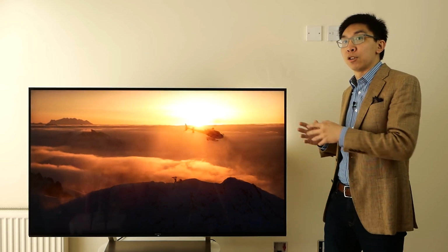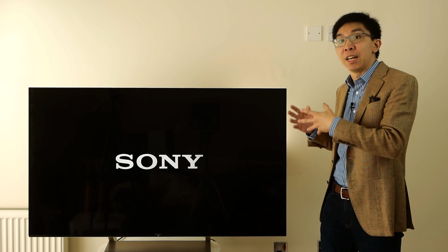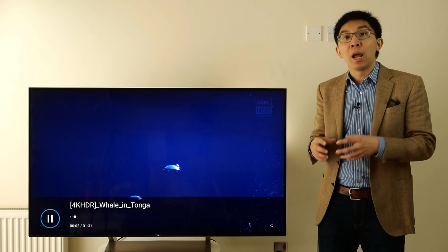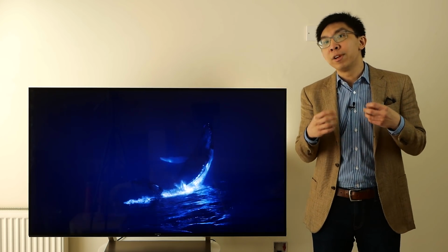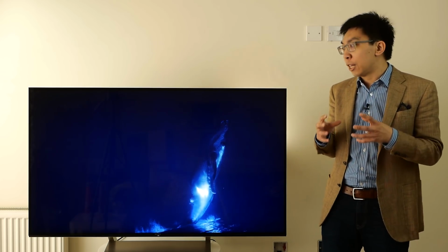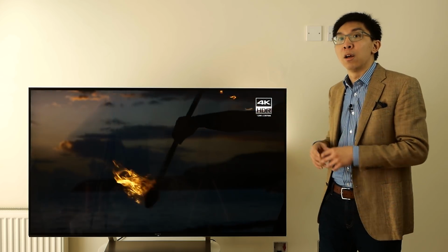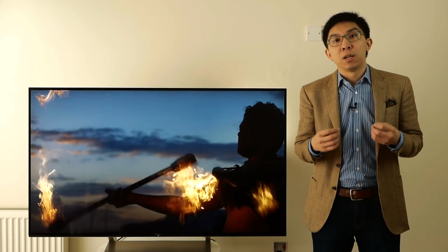Helped by a peak brightness of 1370 nits that could be sustained pretty much indefinitely, the HDR images just pop from the screen. In fact, in anything that's not really a dark scene, the XE93's HDR picture looks almost like a ZD9. Of course, in dark scenes, the flagship ZD9, which has 648 local dimming zones, maintains its deep blacks much better while exhibiting less haloing and blooming artifacts.